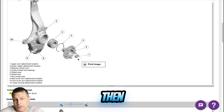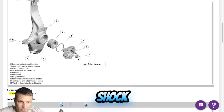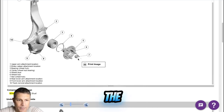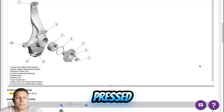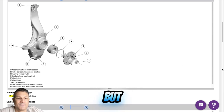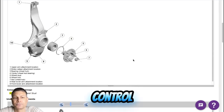Okay. The bearing part is not a problem, but do I take it off the vehicle? Because I can see it's connected to the lower control arm. It's connected to the shock and the CV axle as well. I had already taken off the CV axle nut and pressed it in. It's actually moving, it's pressing inside, but I'm failing to take it off from the lower control arm.